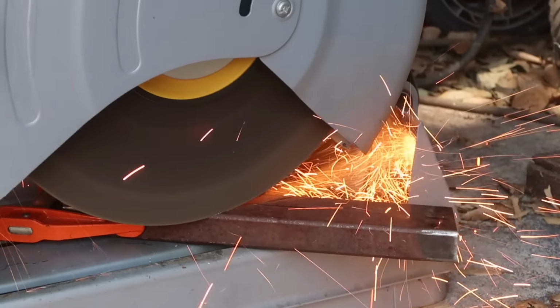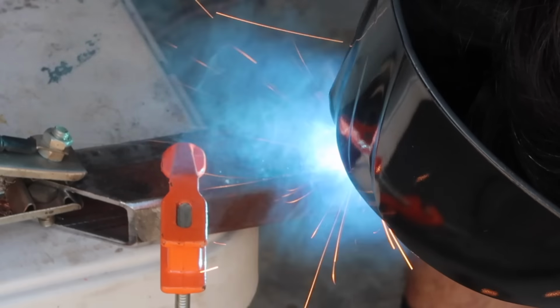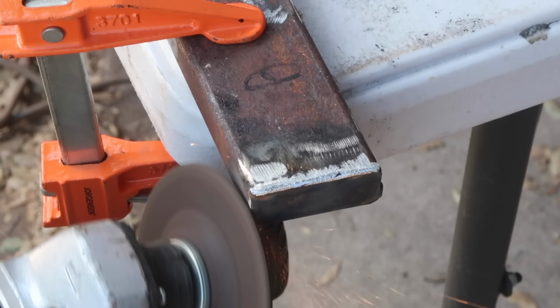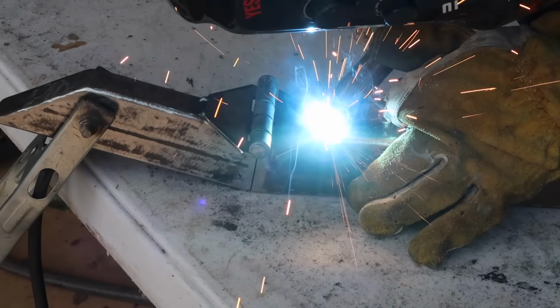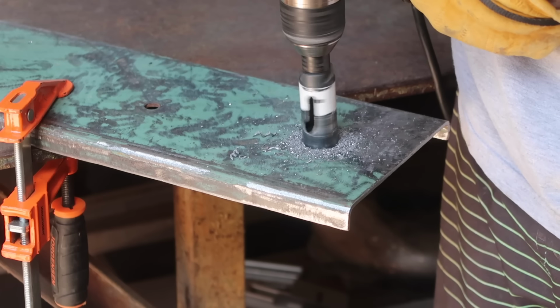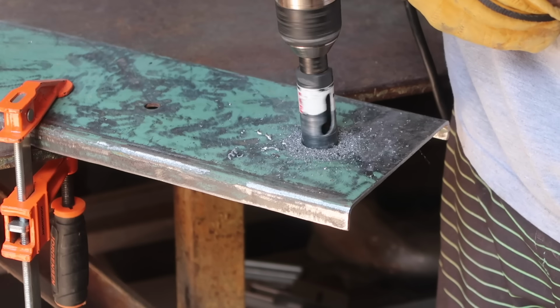These shorter sections are also 1x2 inch steel tubing, and I capped those ends with 1-inch flat bar as well, before grinding down my welds and attaching them to the larger swing arms with modified hinges. This should result in a level entry step if all my math is correct.